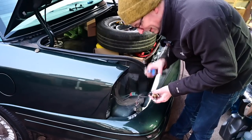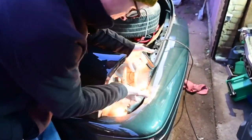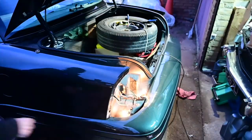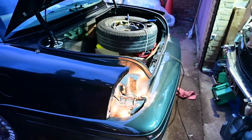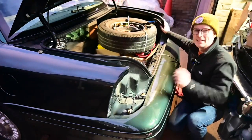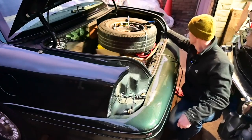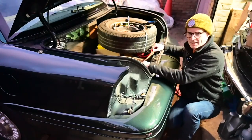Even though I know this is what I'm meant to be doing, it still scares the bejesus out of me. We've now got tail lights which come on with the tail light switch. Let's try the foot pedal for the brakes - I think that worked. Let's double check the indicators don't do anything - they don't. I'm excited! I need to take a spur off this green wire inside the boot, run it down to the other corner, and do the same thing again on that pair of lights. I'll do this off camera as it's getting dark.